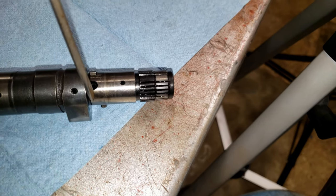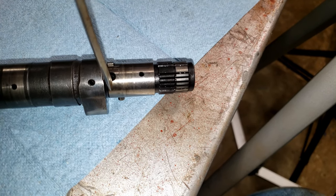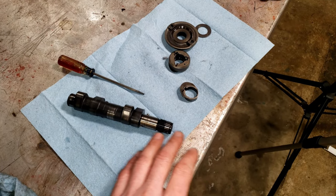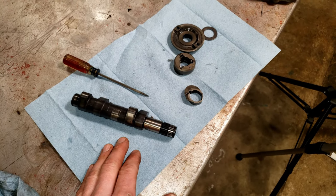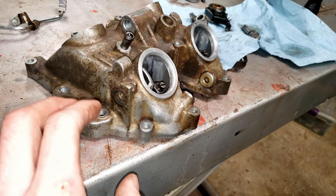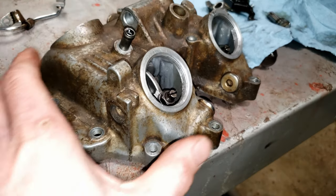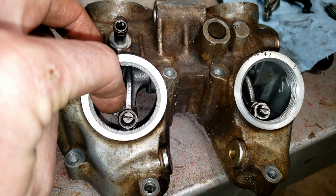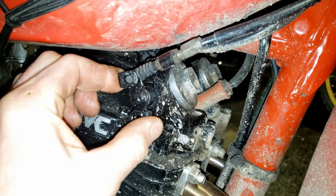Since this is a pretty failure-prone system, it's common for guys to get rid of it altogether and weld up the oil hole so you don't have oil pressure bleeding out. Another good option is to replace the entire camshaft — I looked it up and it's only $175, but you'd want to replace all four rockers at the same time. If it were my engine, I would get rid of it and put a manual decompression in. You could actually machine this out — the casting is still there for the old-style manual lever decompression, and even the rocker has the little pad for that. Much more reliable.